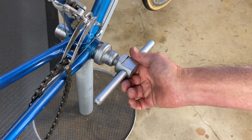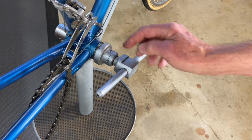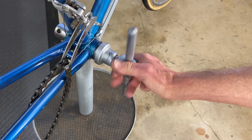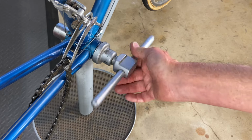Anytime you need to break something like a blue Loctite free, you can just heat up the bottom bracket shell a little bit and the Loctite will release. But if you use a little blue Loctite, which is a temporary Loctite, that cup will not come loose when you're riding. It's a big problem if a fixed cup on this style of bottom bracket comes loose when you're riding.